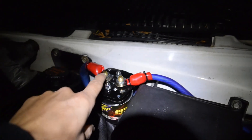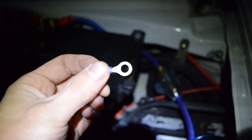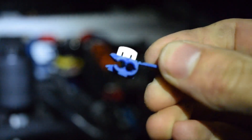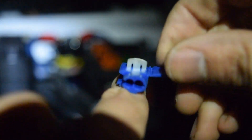I'm going to do the ground first. There's a perfect ground point right here, so I'll just cut a little cable with fittings to connect from one spot to the other. Then I'm going to take the easy route: pull apart this fuse panel and find the ignition wire. I'll tap into it using one of these little connectors — you strip the wire just a tiny bit, stick this thing into the wire, then stick the new wire you want to join right in there, fold it over, close and lock it.